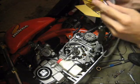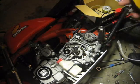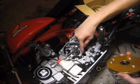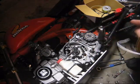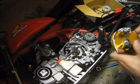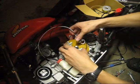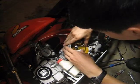Make sure that you install that O-ring on there, and also the oil seal for the crankshaft. I like to dab a little bit of oil on the inside of the seal so that it goes over the crankshaft nice and easy without any problems. Alright, when you put this on, make sure that the coil is towards the front of the bike. And just slide it right on.